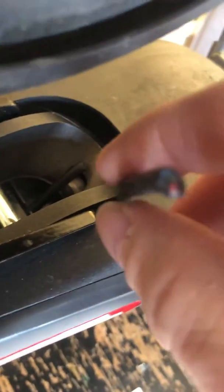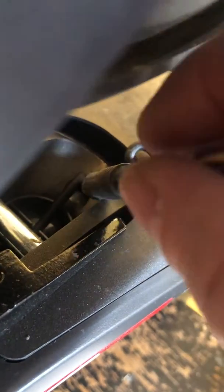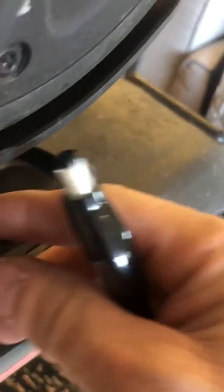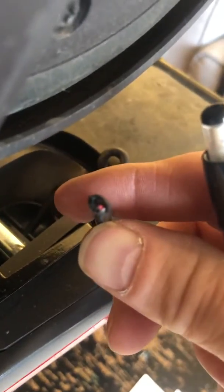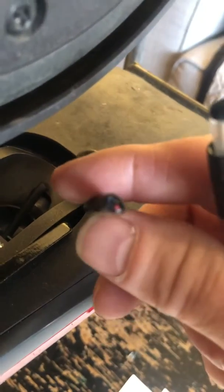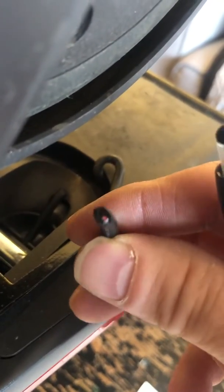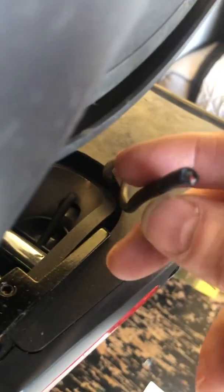I reached further in and was able to pull out the other side, which is on a springy cord that allows it to stretch when it's folded. But apparently it's really sharp right in here, so if that wire gets stuck when you're folding it, it's like a razor blade and it literally cut the wire in half. So if you guys out there are having issues with no brake lights or the undercarriage LEDs not coming on, this is most likely the problem.